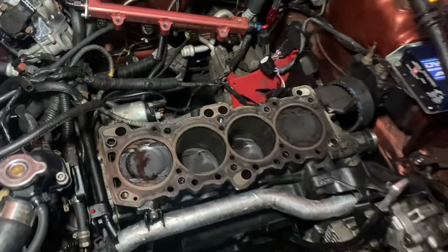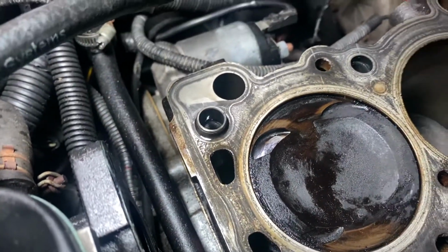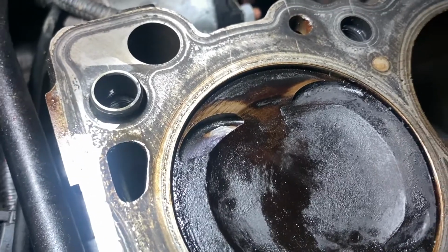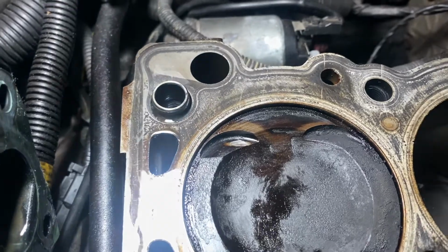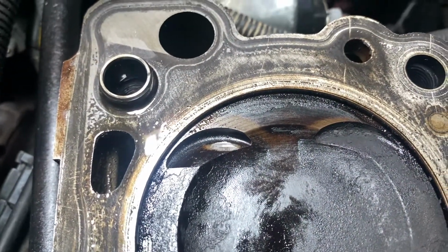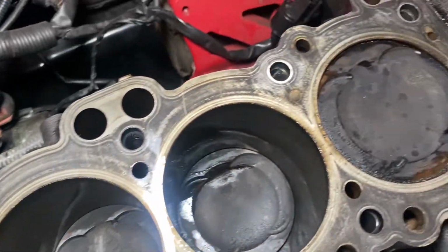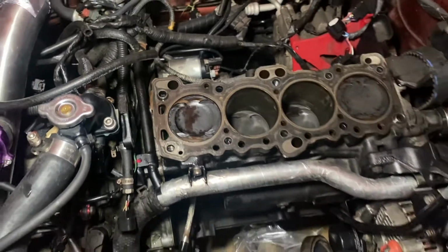Cylinder heads off the car. And if I look closely over at cylinder number 4, or I mean piston number 4, you can see that shiny spot where the valve relief is for the intake side. Looks like the valve hit the piston, or kissed it, when it was at double digits, RPM wise. Everything else seemed to be okay, but I couldn't get compression on cylinder number 4.